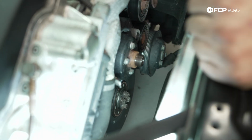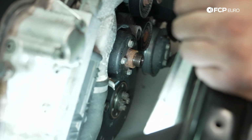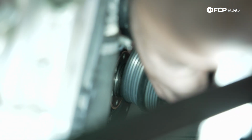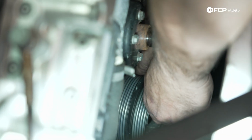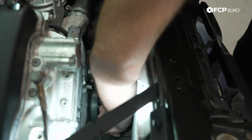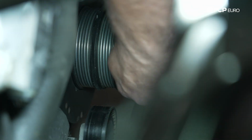Now we're gonna move towards the front of the engine since we have everything assembled up top. We're gonna reinstall our crank pulley here. Remember, remove this in order to bar the engine over by hand. I find it easier to take a bolt with a socket and line it up and try to find a bolt hole in the crankshaft. It'll basically line up pretty much like that.